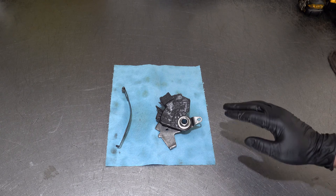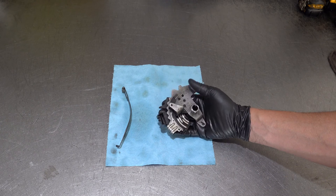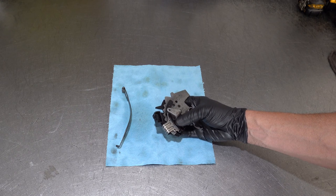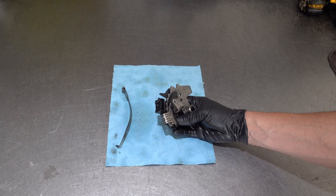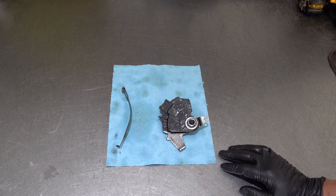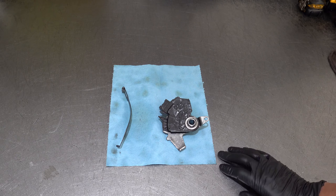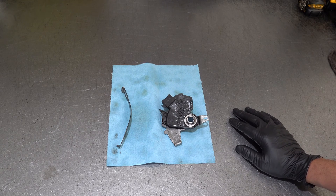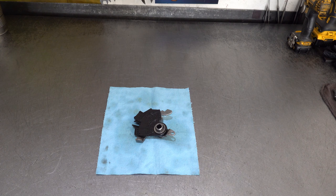This mode switch came out of a 4L60E 2010 model year unit. We put a new one on — anytime you overhaul these things you always want to reset the clock to zero so you're not having this thing be a ticking time bomb just waiting to go off. So now you have an overview of what this thing is, what it does, how it works, and the impact it has on transmission function and on leaving you stranded when it fails.